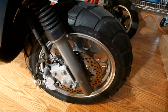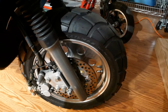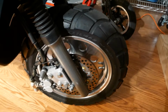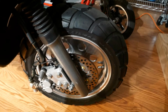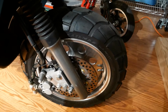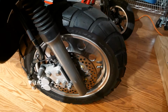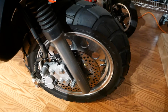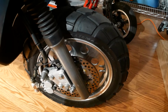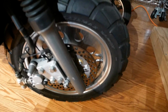If I could find a bigger rotor for the front, one that actually could slightly exceed the grip of the tire, that would be awesome. But this one's close. At full braking in the front, I'm just slightly under the grip of the tire, which is a hell of a lot better than how it was originally. The original brake rotor was probably like 50% of the grip of the tire, and that was for the K413, not these D604s. But anyway, yeah, bigger rotor basically made a difference.